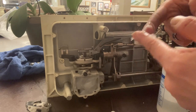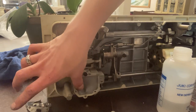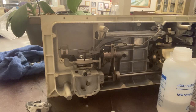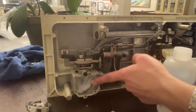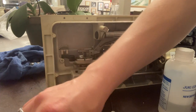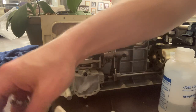Nice, synthetic — look at all that. Once you get it in there, rotate your wheel because that's going to eat some of that grease. Put that back in. You get that little gap right there — I'm going to shove a little more in. That looks beautiful to me. See the difference between this hard glob and new synthetic.